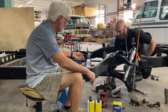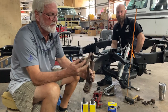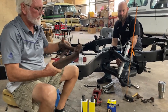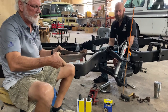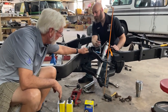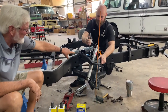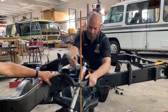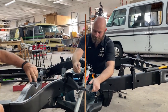Now the upper. This is an upper A-arm. These bushings are how you adjust your alignment — the adjuster's in here. As you turn that eccentric bolt, it will go back and forth. You can see it rolling back. You've got the front and the back; we're only doing the rear bushing right now, but you can do both of them and it moves back and forth.